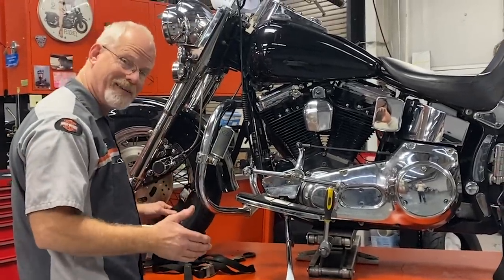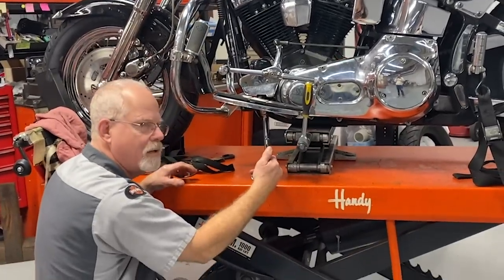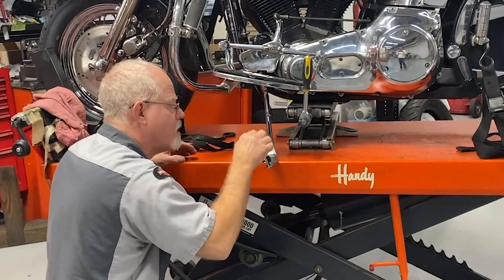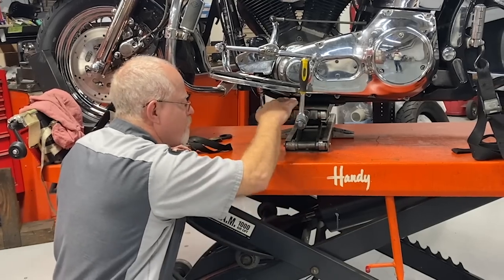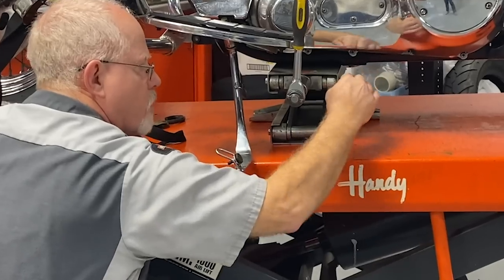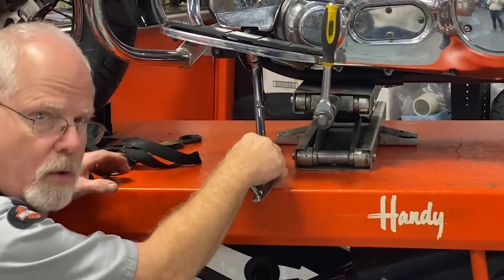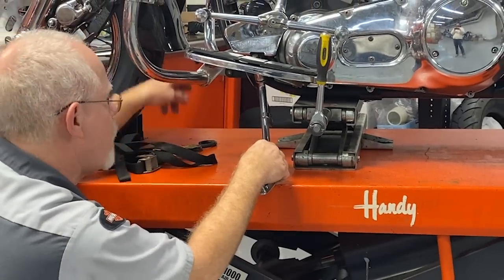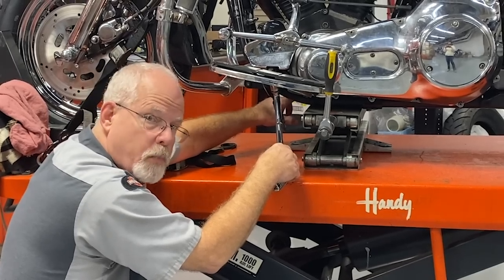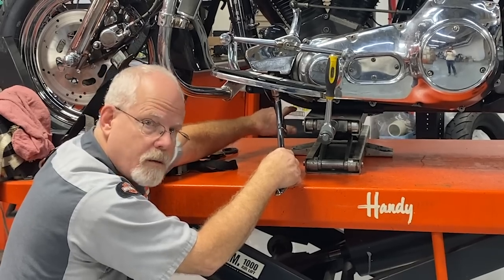Put your jack in while you've got your straps on tight. Find a place underneath. I put the jiffy stand here as a false hope that if it rolls it's going to stop on the jack. Find a flat spot on the frame. If you could see, there is a weld crossover here on this soft tail — I don't want the jack halfway on that and halfway on the flat spot; I need it even on both sides. Now, if you're doing a friend's bike, check underneath please. On older bikes, a lot of guys ran the regulator wire on the bottom of the frame — that can start sparks if you crush that wire. Also, a lot of guys are putting lights underneath their frames, and that can crush and ruin a day. Take a look underneath and make sure there are no wires and no lights before you slide a jack underneath.